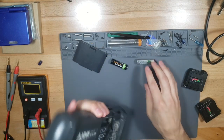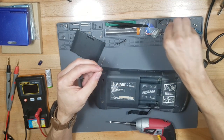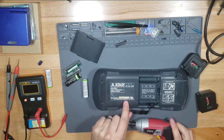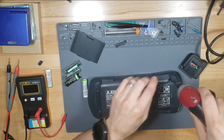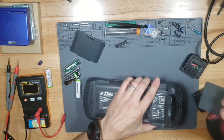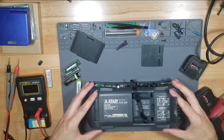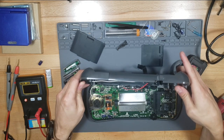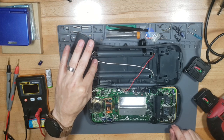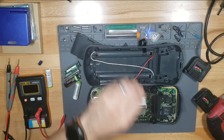Let's go ahead and try to get power to this unit. Look at the size of these screws - this is like a Nintendo screw, and this is the Atari screw. This is made in Sunnyvale, California. It's missing a screw right here - someone opened it before. Let's open it up slowly and see if there are any wires attached. Anytime you open a handheld system, always go slow - you never know what wires are in there. Someone worked on this before. And there's battery acid here and a little bit right there.